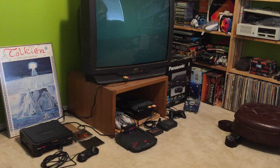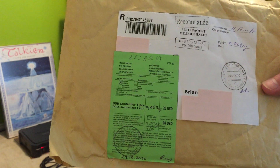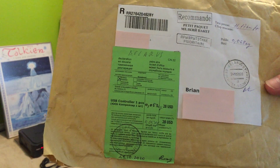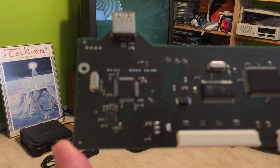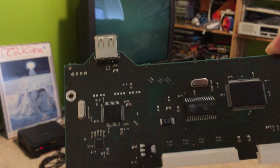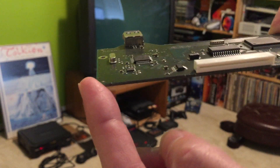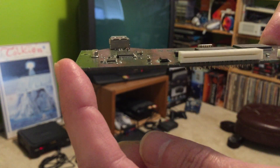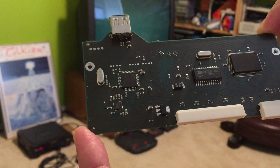So what I did was I went ahead and ordered the part online. If you just Google '3DO USB', you'll find the website 3DO-Renovation.ru. There's a gentleman who makes these parts on there. This is the envelope that I got — it cost about $200 and took about three weeks for delivery. And inside the envelope, with some instructions, is a circuit board that I'll be installing in my next video. On this very small circuit board there's a USB slot on one end — that's where the USB stick with the games will go — and on the other side in these white slots are the ribbon connectors that will be the data interface between this and the 3DO system itself.